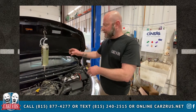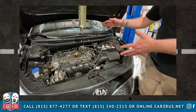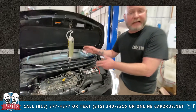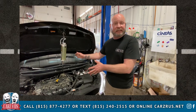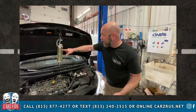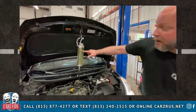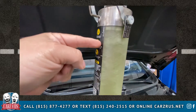So now after that 45 seconds, it's dumped the fluid in there. It revs up the car to 3,500 RPMs, and every seven seconds, two intervals, it will go ahead and clean the rest of the valve. That was the second time, and now it goes through another 45-second interval. As you see, the fluid is going down, and that's going back into the tube and waiting to clean the next set.